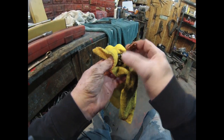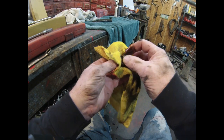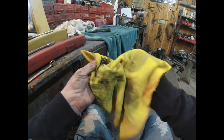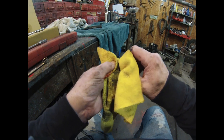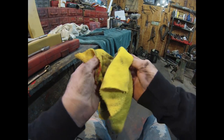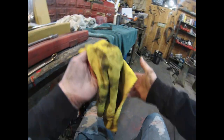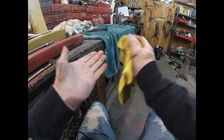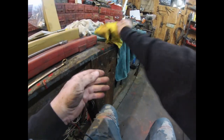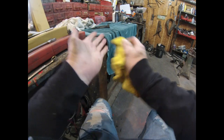Here's the front one — the five-eighths — and it looks pretty good. A little bit of stuff on there but nothing I'm worried about, no big chunks of anything. It looks like normal wear and tear. My bike's got 42,000 miles or so on it, so that's really pretty good looking. For shiny sparklies in the oil or on the magnet — I think that magnetic drain plug is really a smart move. I'd put that on everything if I just took the time. They're both draining now.